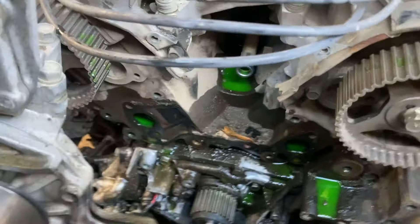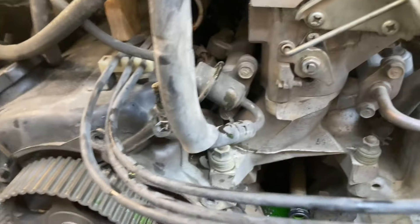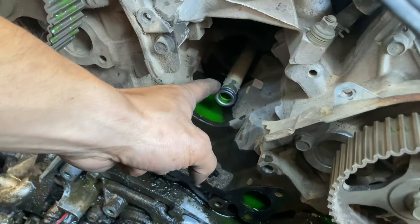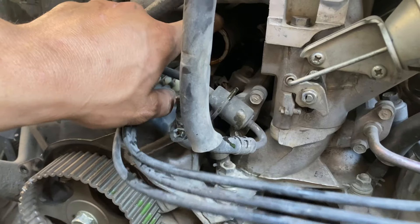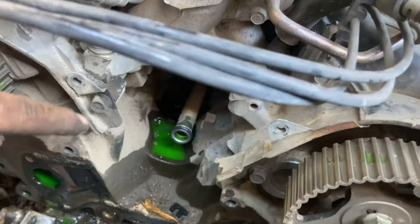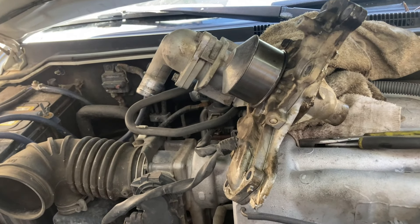I freed the water pump. The easiest way to get this out is to undo all the bolts on the water pump after taking the top section out, and then the whole thing pops off — it's way easier to replace everything like this and reinstall it like this so you can get to all the bolts. Two things to keep in mind: one, you're going to lose a lot of coolant this way, so be prepared. Two, there are two O-rings here — when reinstalling, put a good amount of silicone lubricant on those O-rings so you don't damage them.